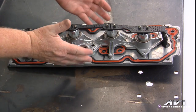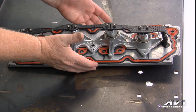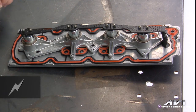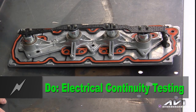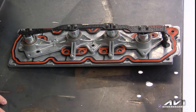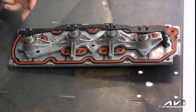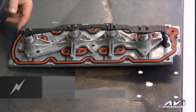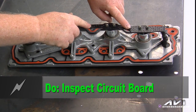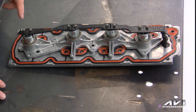I've got one removed from the engine. It usually is situated right between the cylinder heads, and I've got it flipped upside down to talk about one of those do and don't do kind of things. One of the things you do want to do is electrical continuity testing, and if you do find an open circuit or high resistance in a circuit for one of these four solenoids that deactivate one of the four cylinders on the V-8 engines, you may want to inspect this circuit board right here that connects the connector down here to each of the four solenoids.